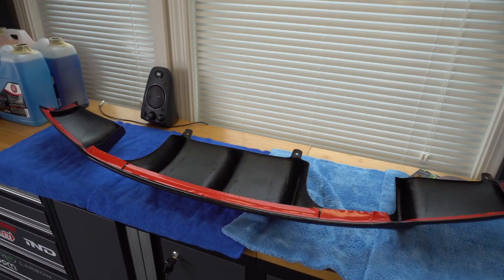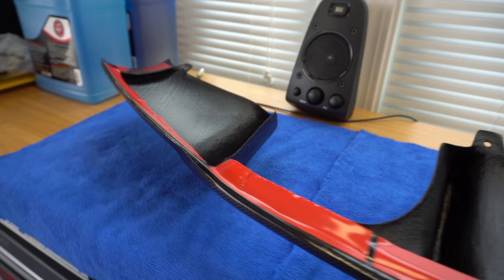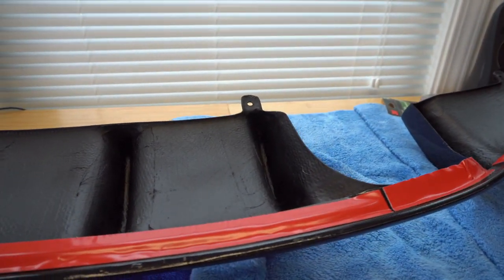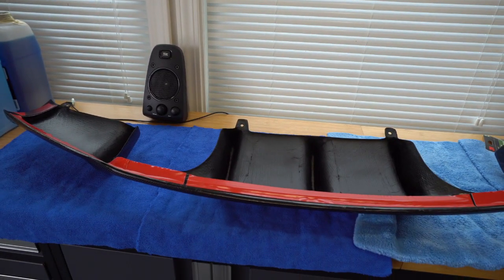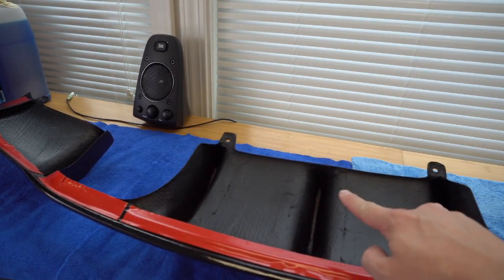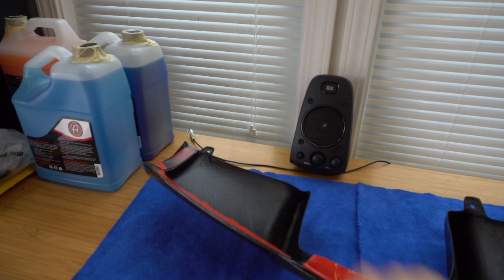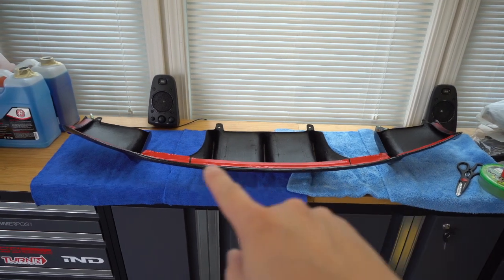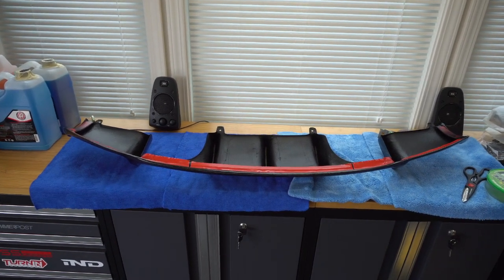I've got more than enough tape on here. Once you get it on, you just want to make sure you press down firmly so that we've got a good bond between the tape and the diffuser. The middle section doesn't really touch the bumper all that much so I'm not too concerned about putting tape there. Since we've got mounting holes on the back — one in the middle section and one on each side — that should be more than enough to hold it on. I'll probably follow it with a really thin bead of caulk just on the edge right up against the bumper, just in case we have any gaps.